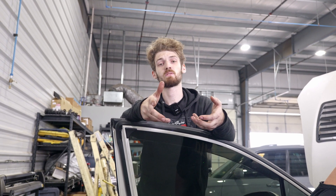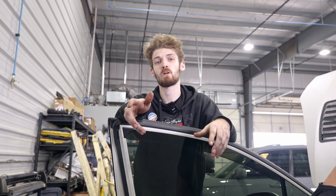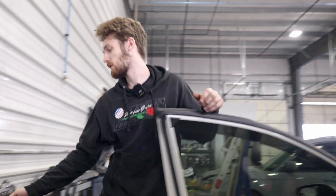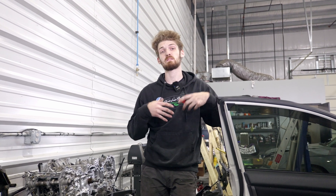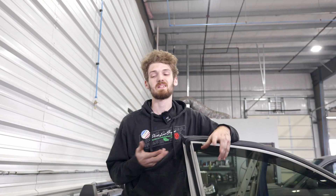This one has a Killer B rotated manifold setup on the bottom for the turbo, so it sits a little farther forward and he can run a bigger turbo. It's got port injection and a port injection controller. It has FA20 cams with the FA24 bottom end — a real Frankenstein. The cam gears are a mix of FA20 and FA24, and it has an FA20 manifold off a BRZ, which allows port injection and flips it to be front-facing. We rotated around up top for different charge piping setups, less heat soak, and to get away from the top-mount intercooler so we can be colder on intake air temps.